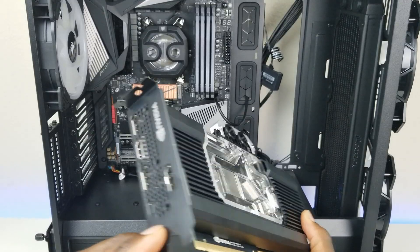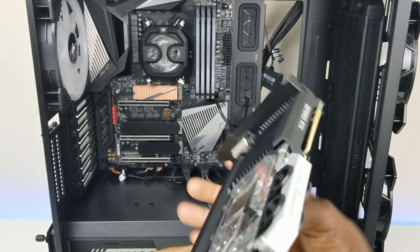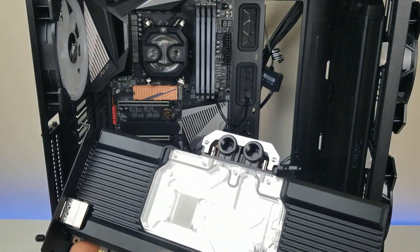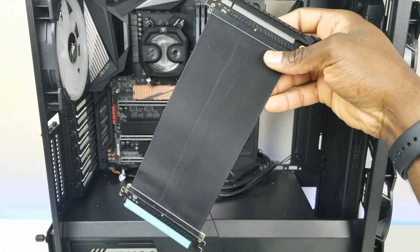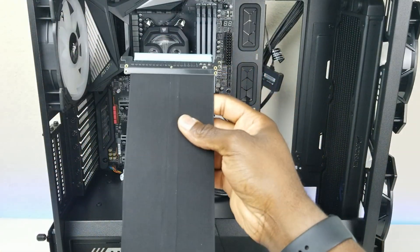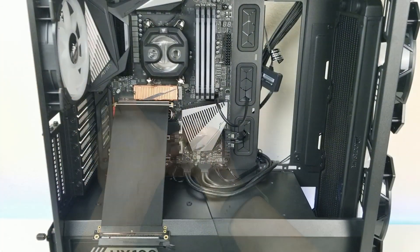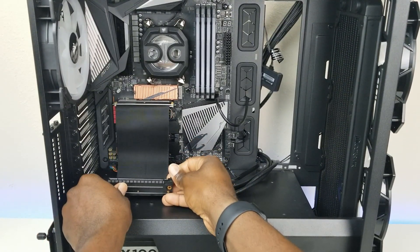You can see the ports on the back, the RGB wiring coming out the side. I went ahead and installed the plug in the back — two water lines will go in the top as in and out ports and circulate through the system. Before mounting the GPU block in the case, I want to make sure the PCIe extender is installed first. It goes in like this and does take a little bit of force — there we go, it's installed.